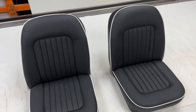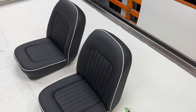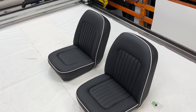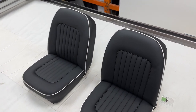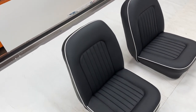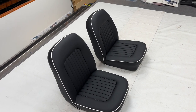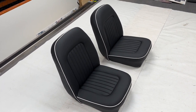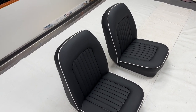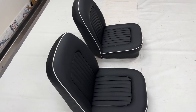It's worth bearing in mind that the seat frames for these were identical to the last version of the TR4 seats — the car before the TR4A. The TR4s had three different types of seat covers over the course of two different frames. The very last version, which is the tubular frame with the square back panel, is identical to this TR4A framework here. So the only thing that would change would be the foams and the seat covers, but they are effectively interchangeable.